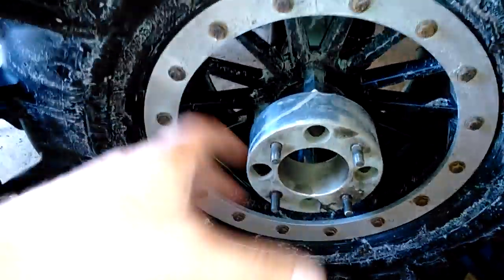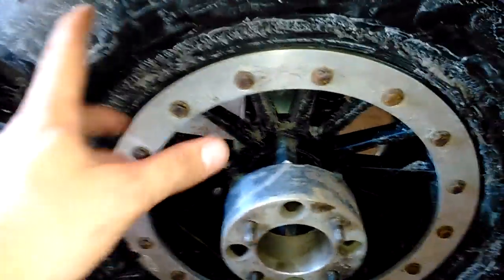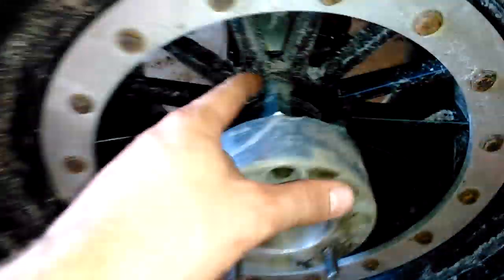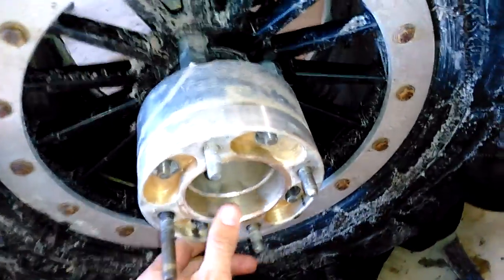So what you do is you have it to where when you bolt this all together, it sandwiches your 2 wheels together. And then furthermore, when you put this sucker at 10-15 psi, it really sandwiches against this wheel hard, making them one solid unit and making these things reliable. So the trick to do that is, you put this on, bolt it all down, whatever, and on my particular setup, I need one more spacer, because these wheels really aren't 5+2, they're more like 4+3.